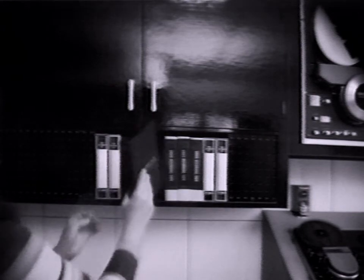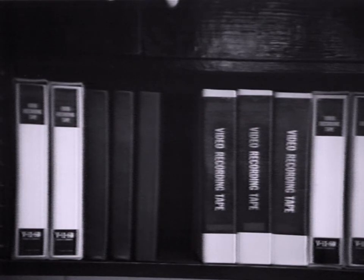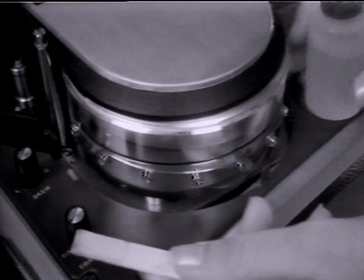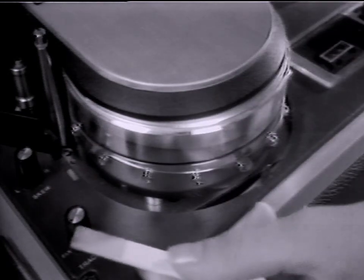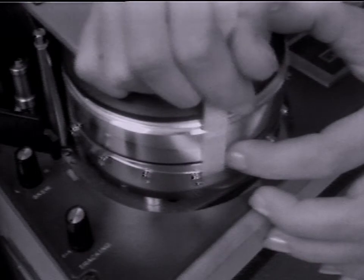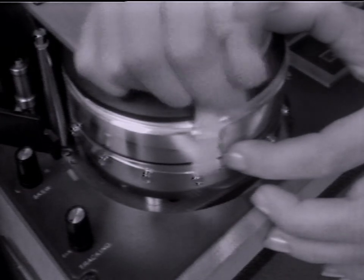Maintenance of video equipment. Many videotaping problems could be avoided by proper care of the videotape itself — it should be kept clean and away from heat and high humidity. Tape should always be returned to the cellophane bag and placed in the box in an upright position. Avoid touching the tape itself while handling the reels, and be certain to use the same size reel for the take-up and supply sides. Frequent cleaning of the heads on the video recorder is of prime importance for top performance. Always use the cleaning sticks and fluid supplied by the manufacturer. For best results, apply the fluid directly to the head cleaner and hold the rotary head gently, removing deposits by rubbing in an even back-and-forth horizontal motion — never use a vertical motion. Proper cleaning produces better taping and greatly prolongs the life of the recorder.